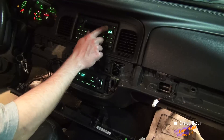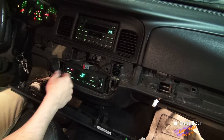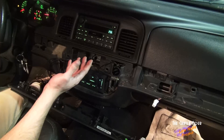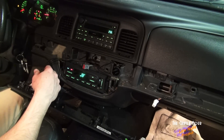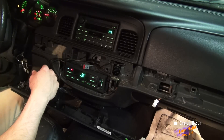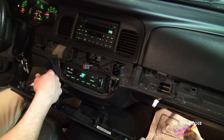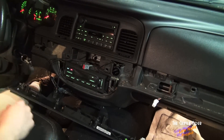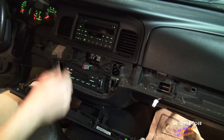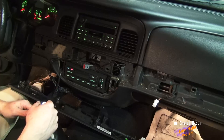Another test I'm going to do is actually take it out and drive it. Even though it's working here now, I want to increase the vacuum pressure on the solenoids and make sure they hold even when I'm accelerating. I'm going to take this car out for a drive — go ahead and reassemble it. Hopefully everything works great after the drive. I'm pretty satisfied with this project. It's a very simple project and you can save yourself a lot of money.